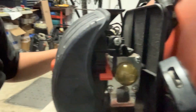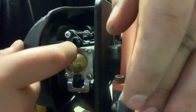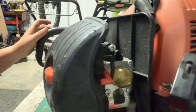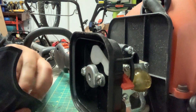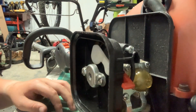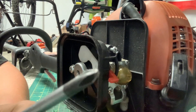You could try squeezing a Phillips or flathead in there without removing the base, but it's too much hassle. The easier way is to first unscrew this knob to take off your air filter cover. Underneath that is your air filter. Then take off these two screws with a Phillips screwdriver.